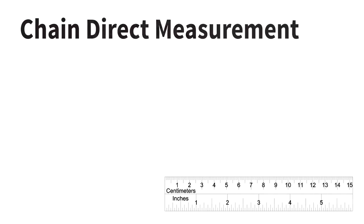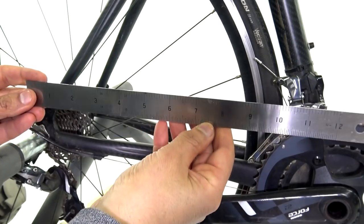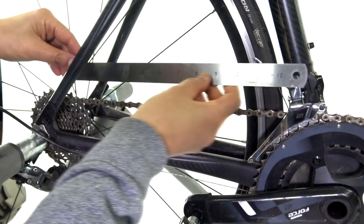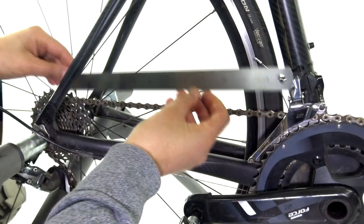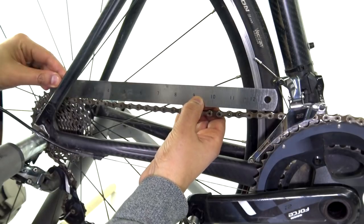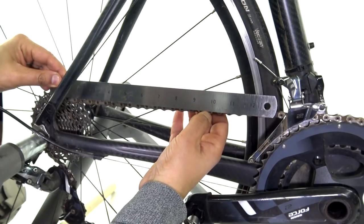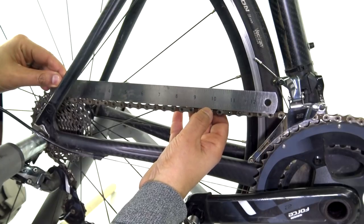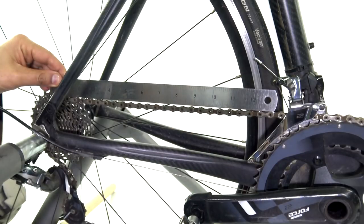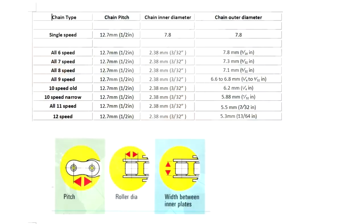What is my fancy direct chain tool measure? Yes guys, it's a ruler — a simple ruler. Now you don't want to use a tape measure. You don't want to use an old wooden ruler that may be inaccurate. We're talking about tight tolerances here — 1% of the total chain length, or maybe even 0.5%. For those with top quality 11-speed or the latest Campag 12-speed chain, those tolerances are very tight. Those chains are very well made, so we're going to have to have a precise measure.